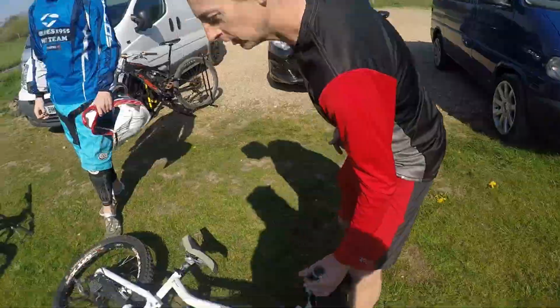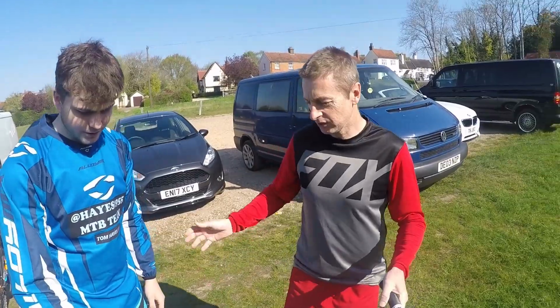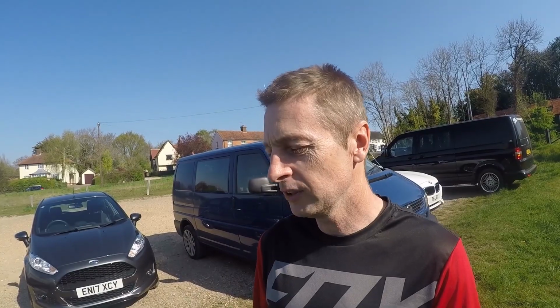So we'll have a look at your bikes first, Tom. And the first thing we need to check every time we go out is the tyre pressures. That's the first thing that connects us with the ground, and if we get that wrong, we're going to be fighting it all the way. And it'll be different for different terrains. General rule of thumb is between 25 and 30 psi.